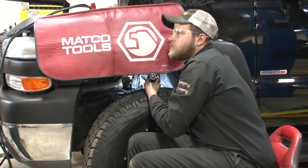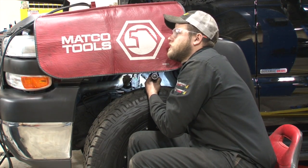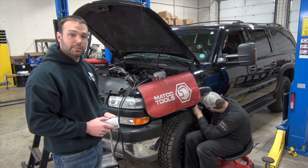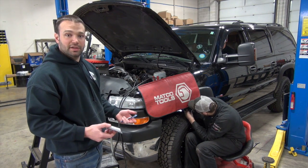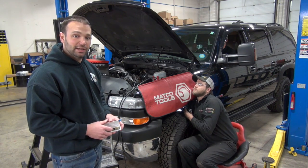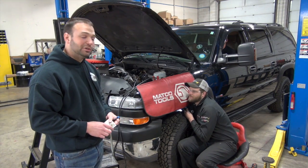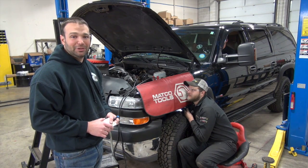There's also a good way to find out if you've got bent rods at the end of the season. If you're a sled puller and you're on borrowed time — maybe running the stock long block at 750 horsepower — you want to do a compression test at the beginning of the season and a compression test at the end of the season. You might see that you went from 350 PSI cranking down to 280. Well, that'll tell you something.